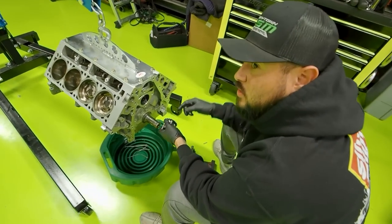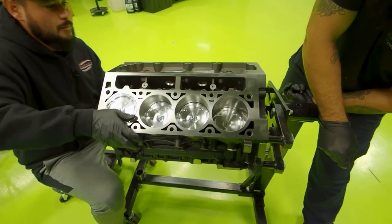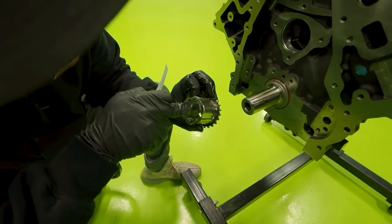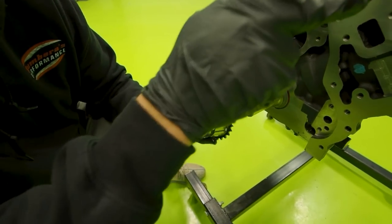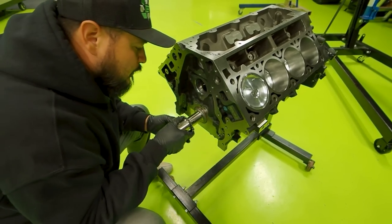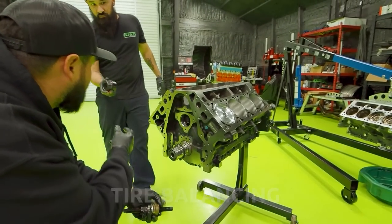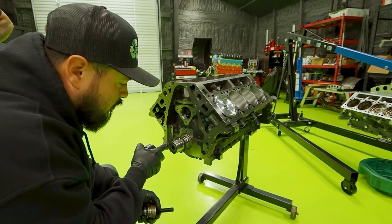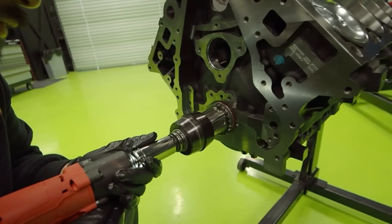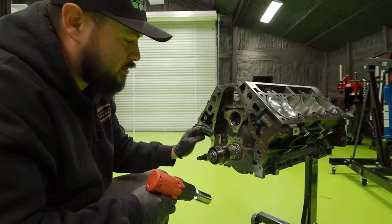It's already at top dead center, so we should be good. The mark will be top dead center at 12 o'clock because cylinder one is at top dead center — the keyway mark sits at 12 o'clock, so we're good. We improvise around here — I'm gonna use one of my tire balancing adapters just because I know it goes over the crank nose but hits on the gear, so I'll use that to push it in. That's how you do it — we walked it in using the tire balancing adapter.